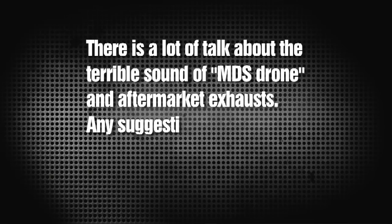Mike Coyle writes asking about MDS drone with an aftermarket exhaust. MDS is a multi-displacement system in Chrysler engines - when cruising on the highway it cuts off half the cylinders to be more fuel efficient. The problem is when that happens the sound note from your exhaust changes, and if your aftermarket exhaust doesn't accommodate for that tone change, you'll get a bad drone inside the car or cab. I recommend talking to the manufacturer and asking specifically if they handle MDS drone for your Hemi engine. If they don't have a good answer, don't buy it. Also check online forums or head to the Motors TV website forums.